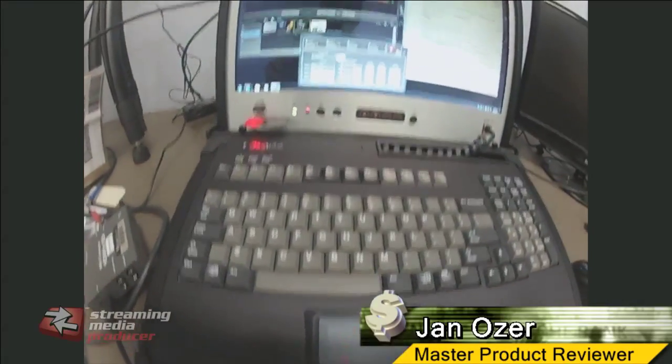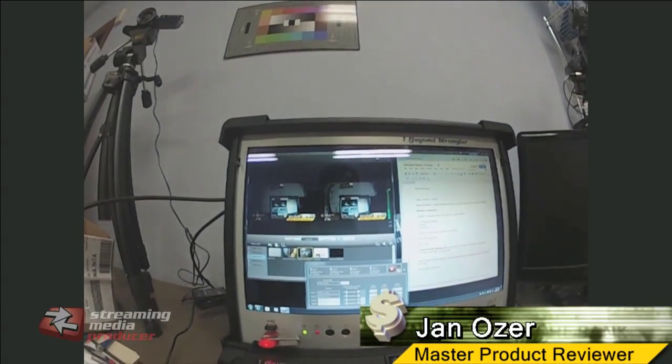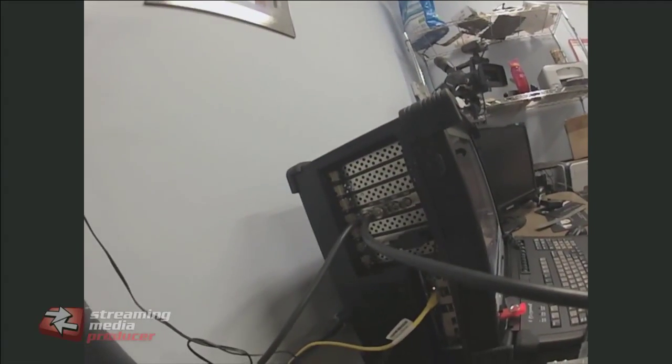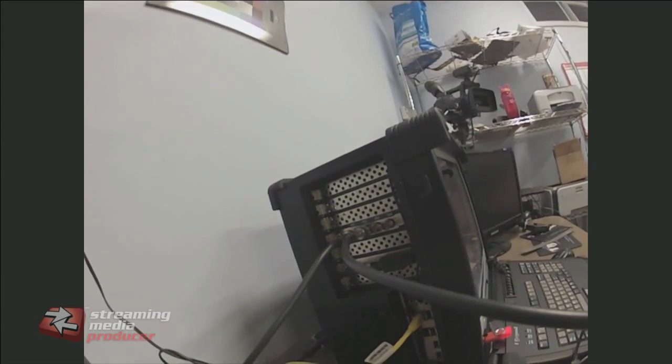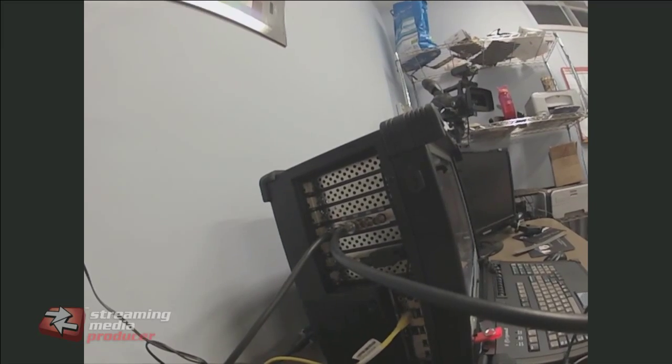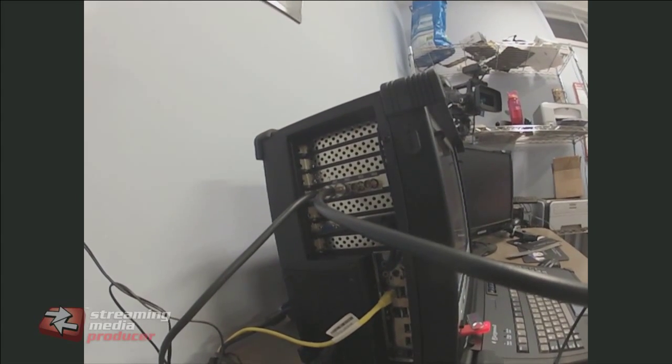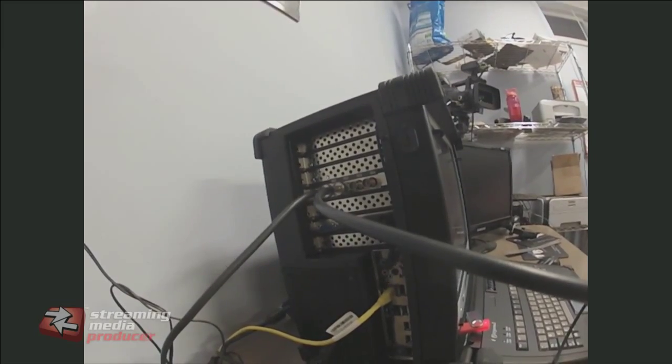I've been testing two systems from One Beyond. Let me show you this one — it's a beast of a system but a real high performer. It's got an embedded keyboard and a 17-inch LCD panel. Here's the side view and you can see how many slots you have. The slot with the BNC connectors is obviously the VS4, and there are three slots above that and two below it. There's an NVIDIA 620 card in here — not a Quadro — so you've got plenty of slots if you need to do things beyond video capture.